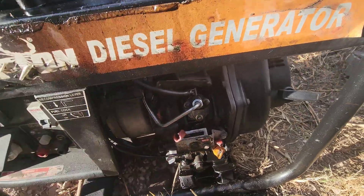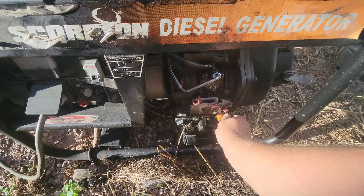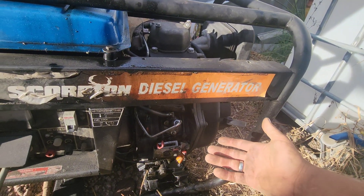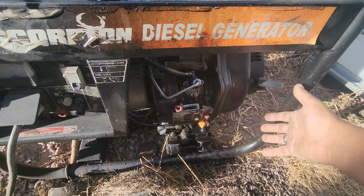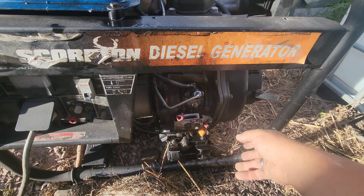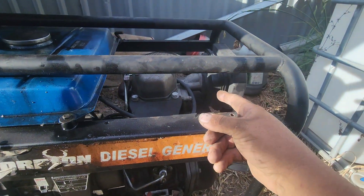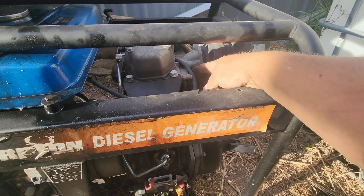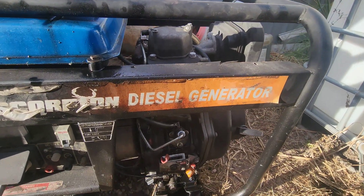We won't start it again. If you don't know what a diesel runaway is, it's when it runs on its crankcase oil or anything getting into the air intake - and that normally ends poorly. I turned the fuel off and it didn't change; it actually revved higher because the air-fuel ratio changed to a less rich mixture, even though it was still boiling oil in the crankcase ventilation. This intake port is actually part of the front of the case - one piece through there - so I'm assuming it vents from the bottom all the way to the top.